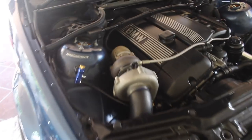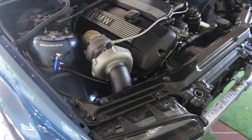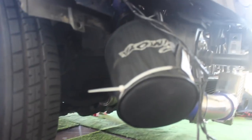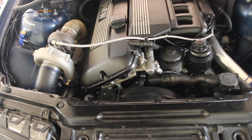Just a quick update: I have changed the exhaust wrap to this titanium wrap. I've also got a new beanie for it which I think looks a lot better. And I have changed the intake routing — it used to go over here across the front of the engine, but now it goes down through there. I had to cut a bit of the strut wall out, and then it comes down and the pod filter comes down into the front bar. It flows a lot better now with less intake piping, and it also looks a lot cleaner without it running across the engine bay.